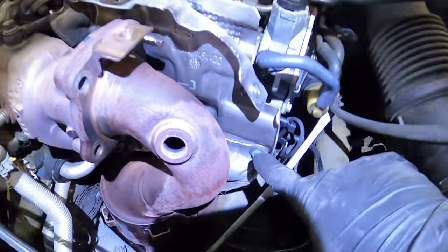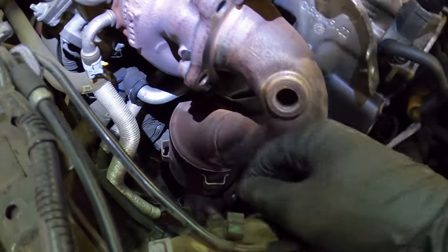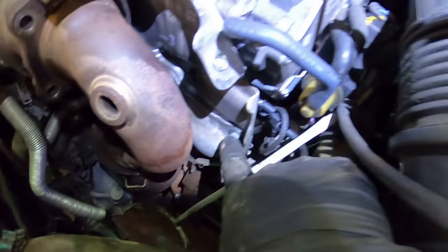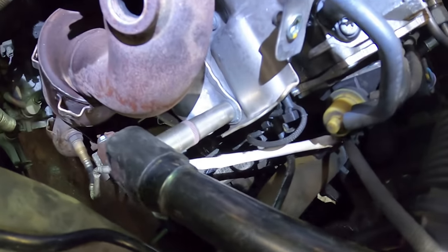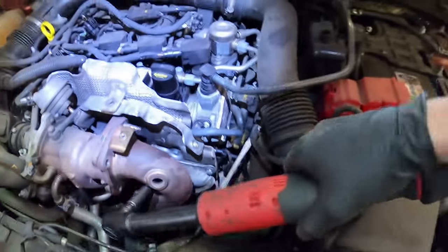I just remembered this little heat shield is actually bolted to the back of the cat, so I took the bolts off the bottom and the little bracket one, and it all wobbles — but it wobbles with the heat shield. You've got to undo this 10mm and another 10mm just in here. I've got the luxury of an electric ratchet. You're going to need an extension for that one.